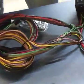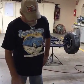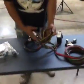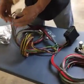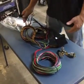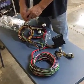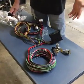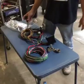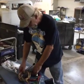So we take that direction when we do turnkeys here. You don't have to do it that way. You can wire different. You can wire your turn signals separate. But this is set up for a plug to go into a column that's got a turn key in the column. So if you use, and we used to do it a lot, some of the older style columns out of the GMs, you can get a tilt and everything else, and you can use that. But on our column, it's a 2-inch OD on the tube, so we use a 2-inch pipe, an ID, and we can just slide that in and get that going. So I've got my wiring kit.